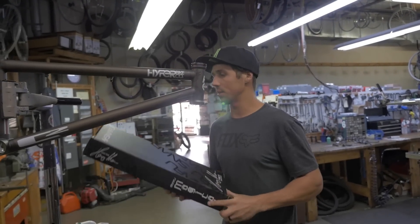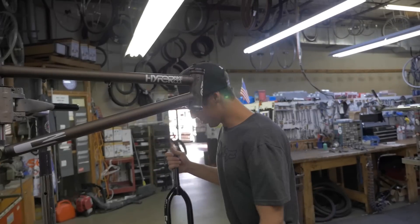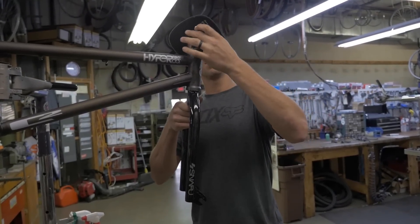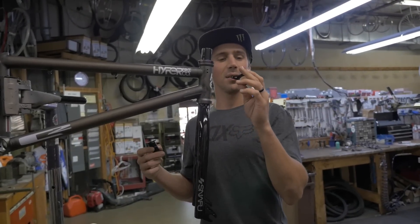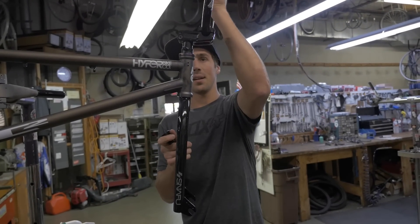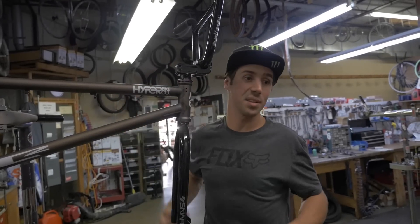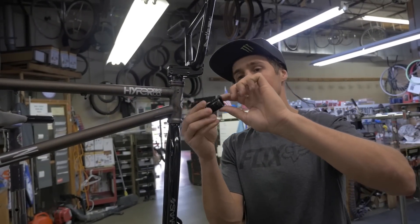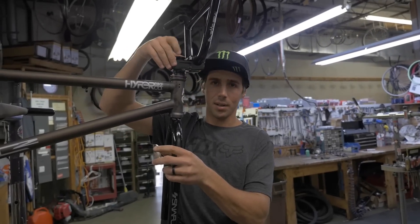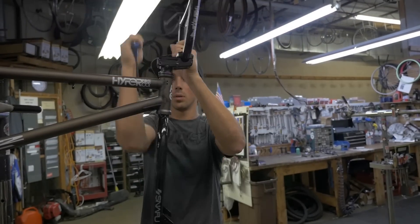Next up, we're going to pop the fork on. I use the SNAFU Magical fork — black fork. These forks are great: really light, really strong, another awesome part that SNAFU makes. I've had this spacer for a bunch of years — it's got built-in gyro plates on it, which is awesome, and it's still holding up so I keep putting it on every bike. Now it's time to put the stem on — my stem is already attached to my handlebars. We're going to grease up this bolt so it goes nice and smooth into the fork. If you don't grease a bolt, especially something you'll take off from time to time, you're going to hear creaking noise. Grease is important. Spins nice and smooth.